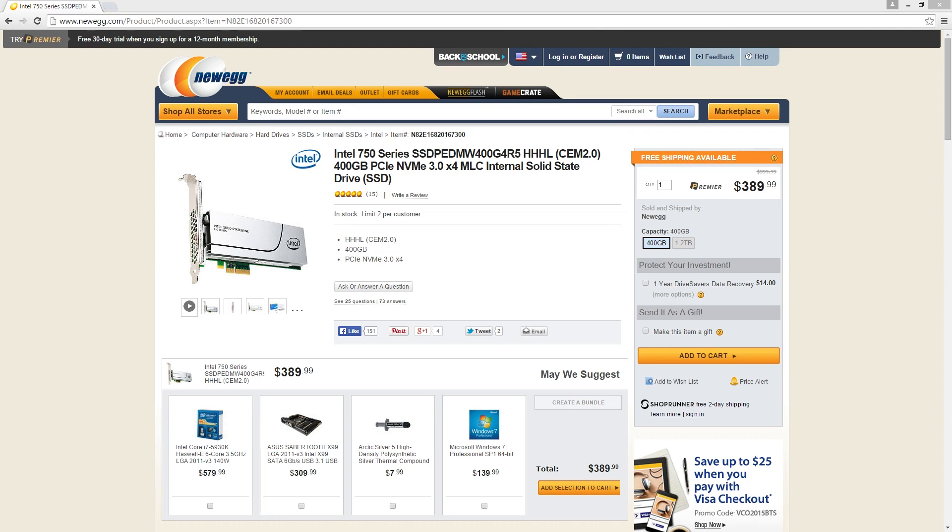It's worth considering this platform if you have lots of PCIe peripherals or are looking at PCIe-based storage. The Intel 750 PCIe SSDs can move over two gigabytes per second, which requires a direct PCIe interface since SATA isn't fast enough. The fact that everything on this platform is PCIe 3.0 is a big help for peripheral connectivity including USB 3.1C. I really think the real innovations for this platform will be in small form factor and portable PCs — tablets, laptops, and convertibles — where the extra connectivity and interfaces will help most.